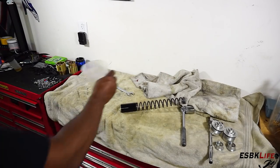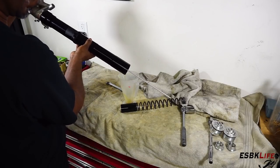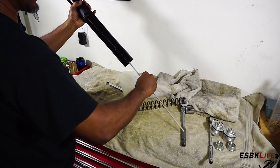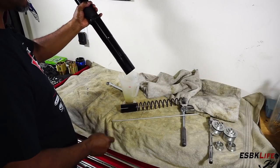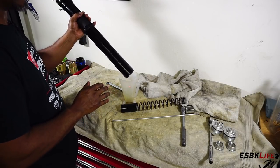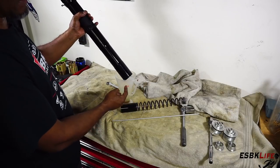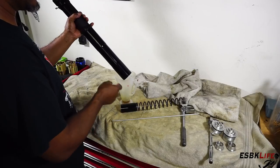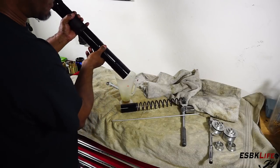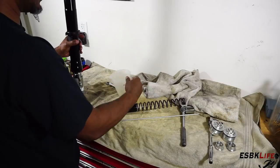At this point, grab your Ratio Rite and dump the old oil in. I've already drained most of the oil — this is the center rod. Wherever the fluid level comes out to, that's your mark. If you were replacing seals for servicing purposes the fluid would come up to a certain mark; you'd mark it with your marker, then clean all the old stuff out, fill your Ratio Rite with fresh fluid to that marker, and put it back in. This one was leaking so I've already drained most of it, which is why we only see a tad bit left in there.